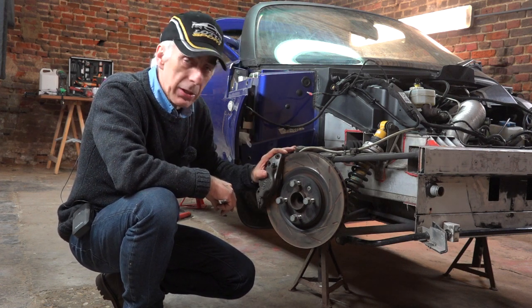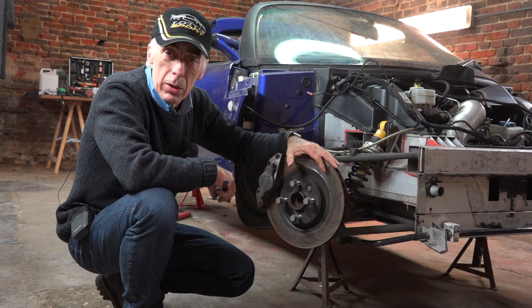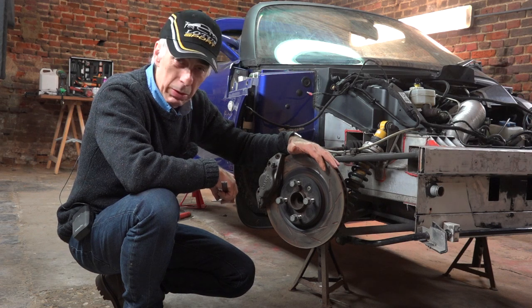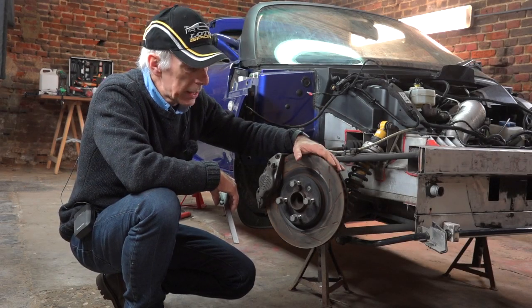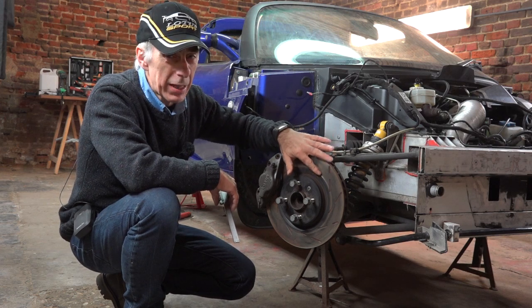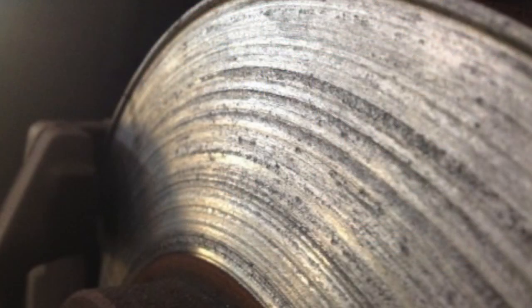I will retain my standard calipers on the car. Your discs will either wear out one day, become faulty or defective, or you just want to upgrade them. A faulty disc is one which is cracked or has deep grooves in it. We've all had brake pads worn out during a track day, resulting in metal on metal that causes deep grooves in the disc — so then you can toss the disc away because you shouldn't be using it anymore.